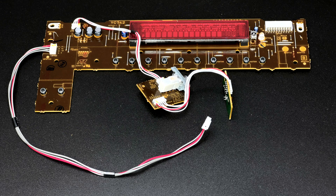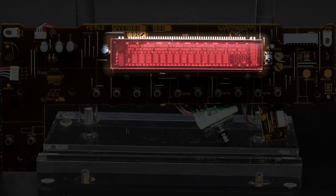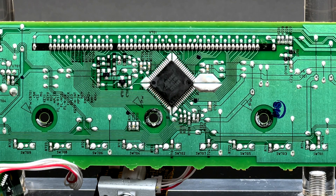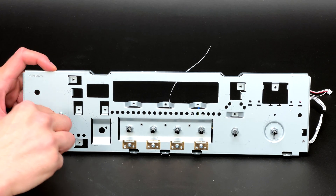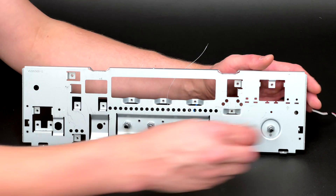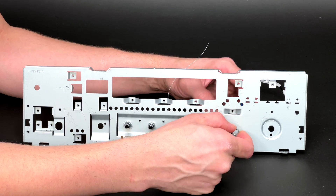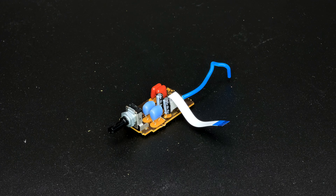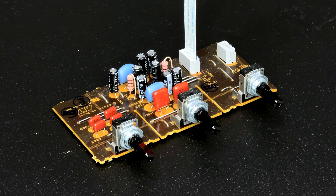Operation PCB 1 has quite a standard look. You can see a dozen of micro-switches, an IR receiver, a vacuum fluorescent display, and on the flip side of the board there is an 18-digit 5x7 segment vacuum fluorescent display controller made by Mitsubishi. Next goes the headphones jack, followed by the volume control knob, input selector, loudness adjustment knob, and operation PCB 3 which has bass, treble and balance control knobs.